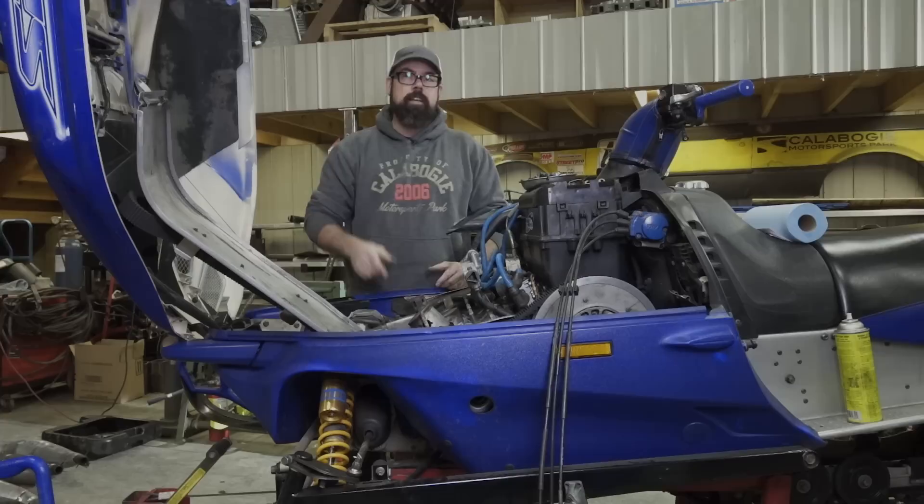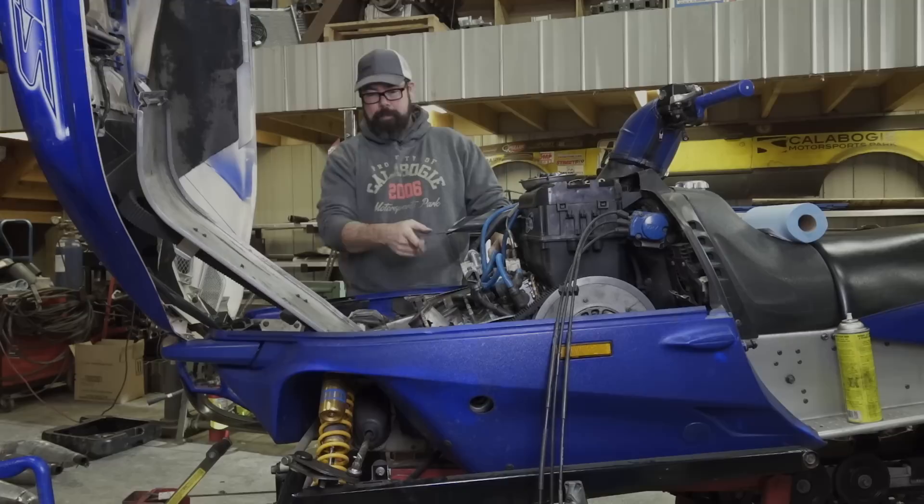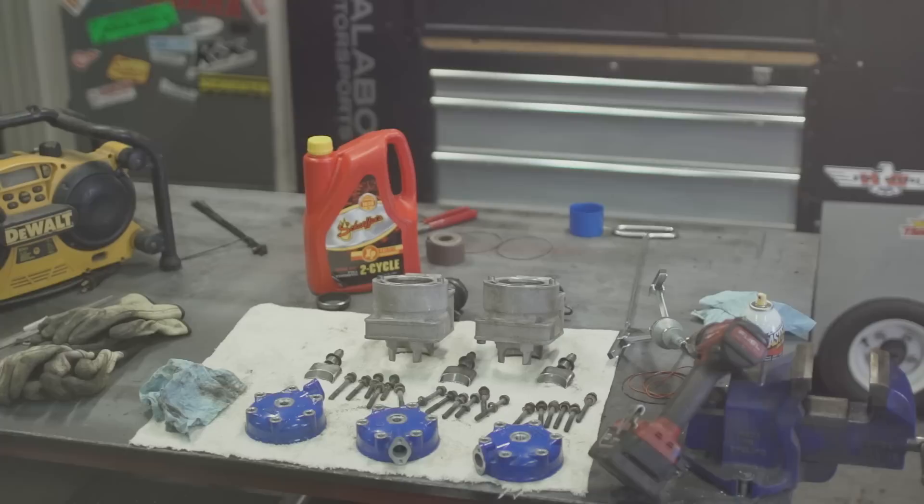At this point we've got everything cleaned up, the old pistons are exposed, the old rings are off, and we're ready for reassembly. For a sled with over 18,000 kilometers on it, I'm pretty impressed with the condition of the pistons and cylinders, so I am comfortable just installing the new rings. I wanted to show this job could be done on a little bit more of a budget, so we're not putting new pistons in. However, if I cared a little bit more, I probably would opt for new pistons — but that would add about $100 per cylinder, almost doubling the cost for this job.